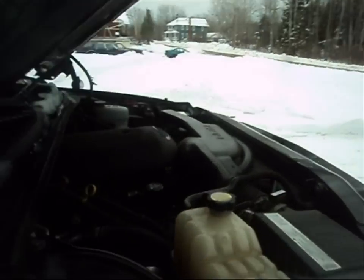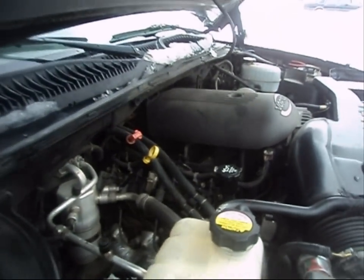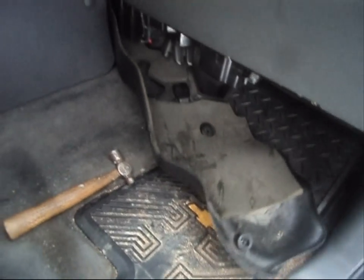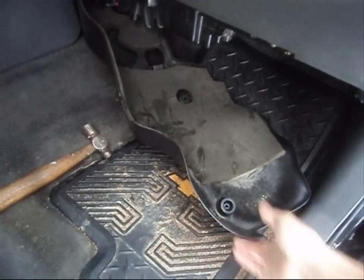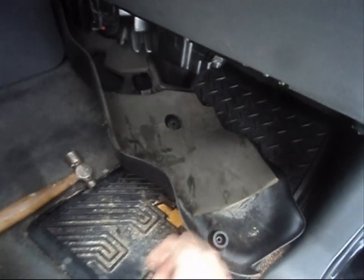Typically you would think that it would be located in the engine compartment like many vehicles back in the 80s, 90s, and even today. Not so. What you're going to want to do is open the passenger door and lower this kick plate. You don't have to remove it entirely — there are two bolts holding the unit in there. All you have to do is have it drop down, and then take a gander in here. Here is your blower motor.